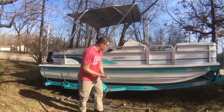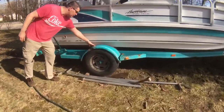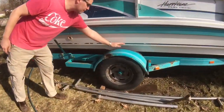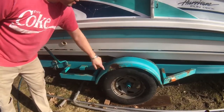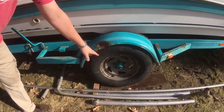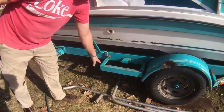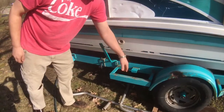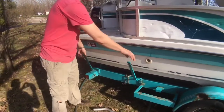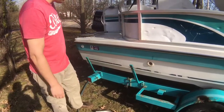We'll start right here. It needs some new plywood and some carpeting. I'd replace the carpeting and lumber behind the fender. There's a little dent in the fender here. Tires are really good — I've towed this personally over 60 miles. It's got fresh grease in the bearings. It needs a piece of wood here as well with the carpet; over time those rot out. You're probably talking 20-30 bucks worth of wood there.